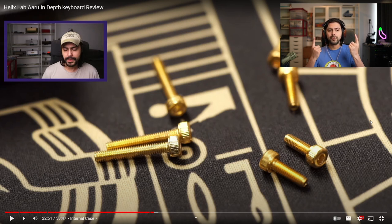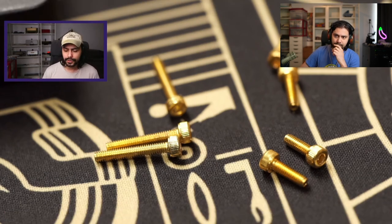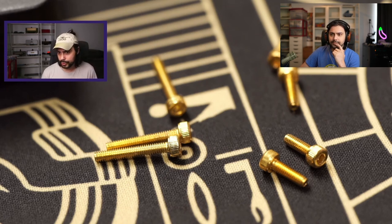Something like the Jaguar, where the screws are inset so far you need the longest screwdriver ever — at that point I would have preferred a longer screw that comes out more, so you don't have to strip your anodization while screwing it in, having to essentially drill deeper into the case and end up stripping anodization trying to get a thick-headed screwdriver in there. All of this can be solved by using longer screws in the back and shorter screws in the front.